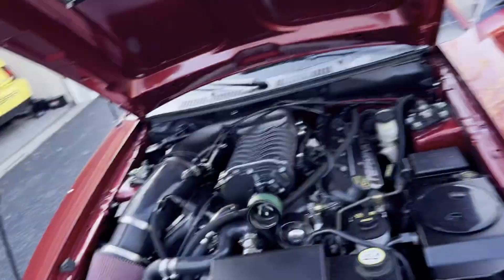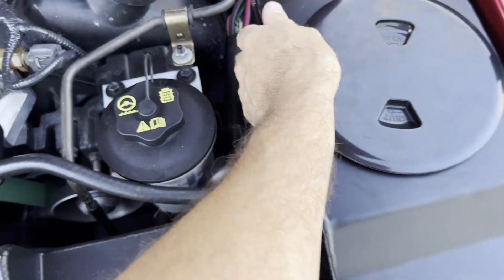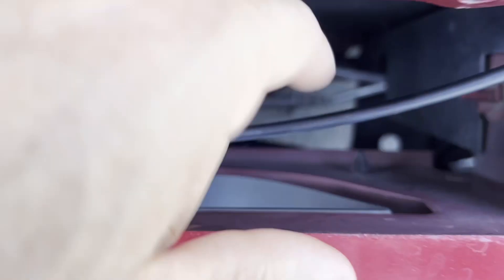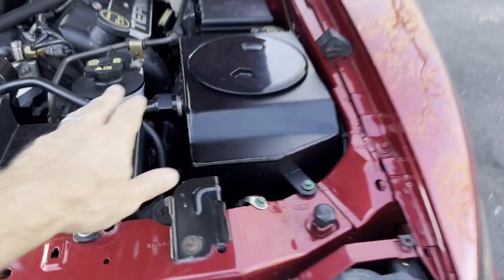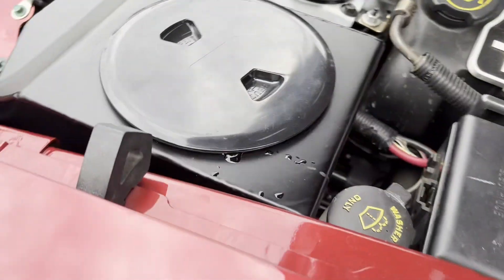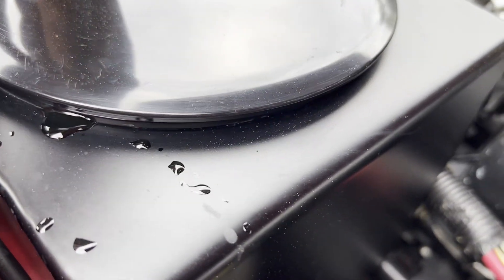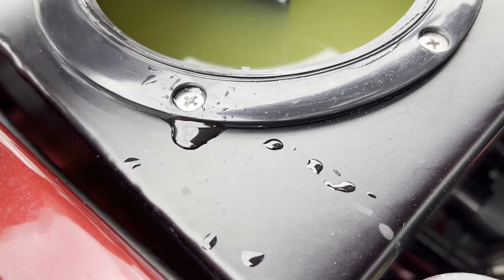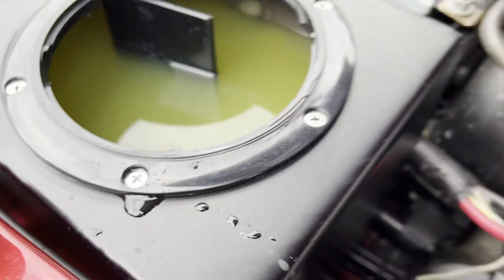So this is pretty interesting. This tank's so hot I can barely touch it. This one is cool to the touch. Yet they're both in the engine bay. All of this heat that's heat-soaking into here is going to the heat exchanger dissipating. That cooling system is working super hard just to pull out engine bay heat — it doesn't seem like the most efficient way to do things. I'm going to say this lid is mostly sealing. I still have a small leak here.